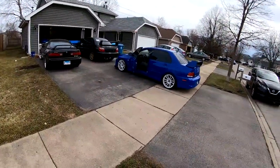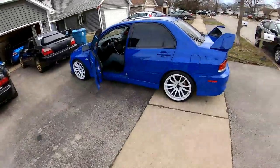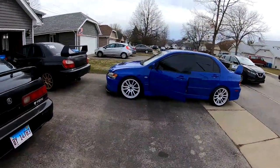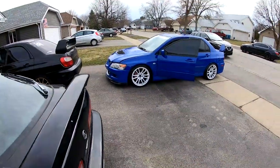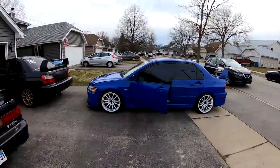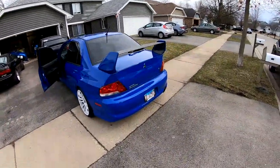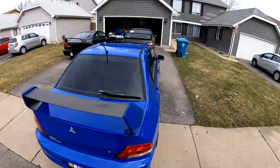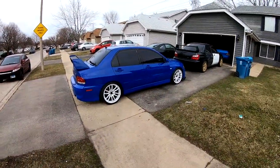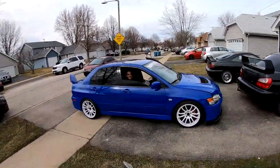We're over at Sheldon's right now. He's got a customer that brought in his car, and it's got a little bit of a weird idle, but it looks like it's tuned for the wrong injectors. It's tuned for like 2200s, and the ones that are in there are like 1500 or 1600, something like that. It's pretty nice. Hello. That's the man right there that owns it.